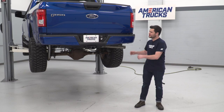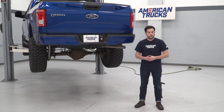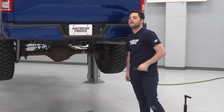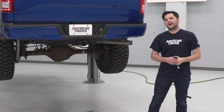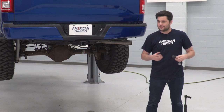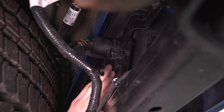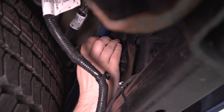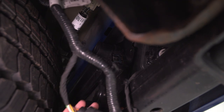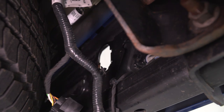Before we go ahead and remove this rear bumper, there are a few things we're going to have to disconnect and then scavenge to transfer over to our new bumper. First thing we're going to take is the spare tire lock — put the key in, give it a turn, and that should pop right out. We're also going to have to disconnect the trailer plug and then pop that out. Same thing goes with the two license plate lights. We're going to crawl underneath the bumper and get those out of the way. For the trailer plug, all we're going to do is unplug it — there's a release tab on one side. Just push that down and work it right out. And there are two release tabs on the housing, one on either side — push those in and it will fall out the front.